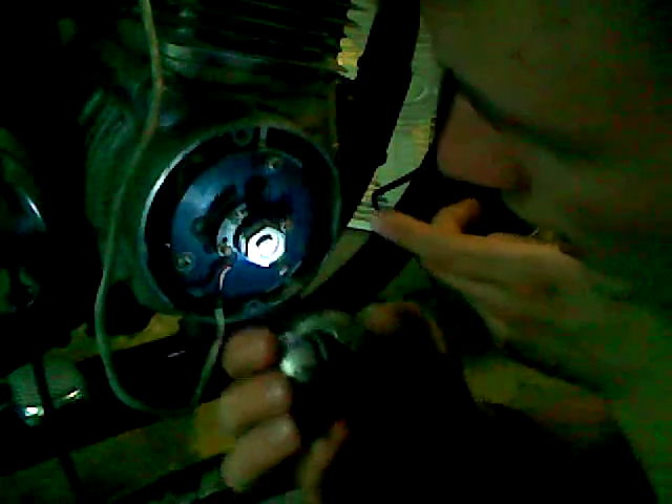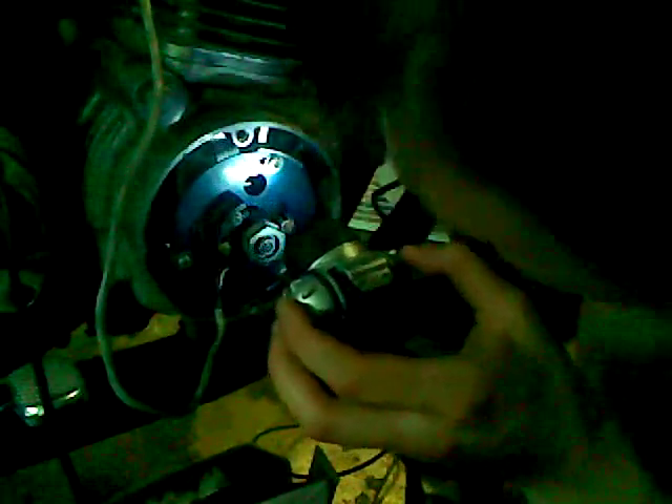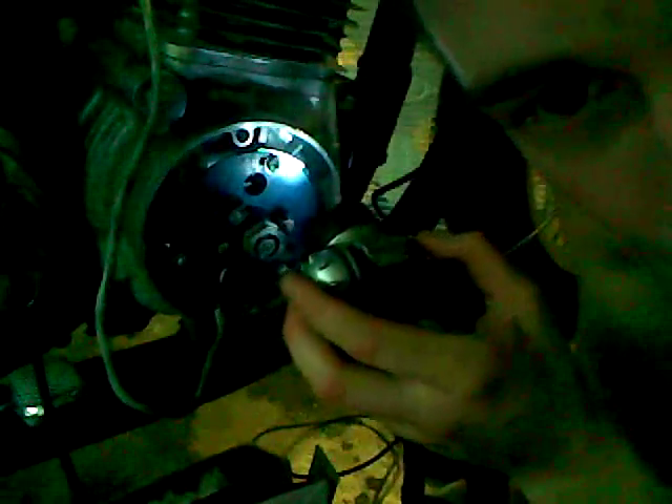You can't just have spark — you have to have it timed right. So on the CB750, they have a few markings that enable us to adjust it correctly. Here we have the timing, the spark timing plate, which causes it to spark. As you can see, there's a hole at the top of this disc, and through that hole you will see on the crankcase a little mark, which identifies at what point it is sparking.